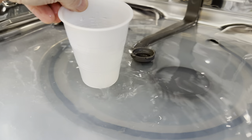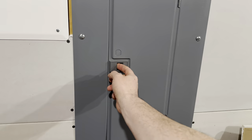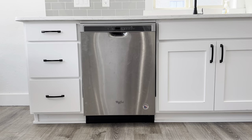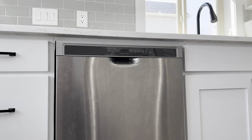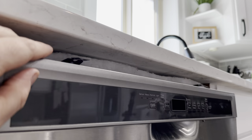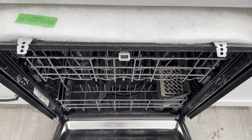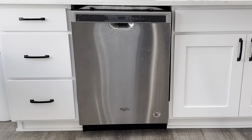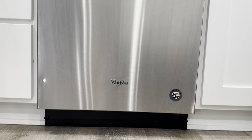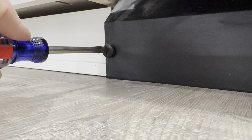So now I'm going to step 3. I'm going to first drain all the water, then I'll turn off the water line, and then I'll flip the breaker to kill any power going to the dishwasher. I'm going to test the washer to make sure there's no power, then I'll need to remove the two bracket screws that are holding the dishwasher in place. These screws are usually located on the edge of the dishwasher and you can get access to them by opening the door, then unscrewing these metal tabs that are holding them in place. We turned off the water line and killed the power and undid these two brackets so that we can gain access underneath the dishwasher. I'm going to lay on the floor and undo the two bolts or tabs that are holding the dishwasher cover in place. I'm going to use a flathead screwdriver to untwist the bolts and the cover will come right off.